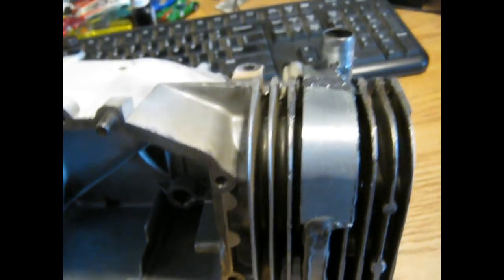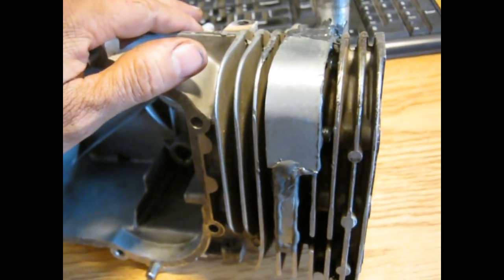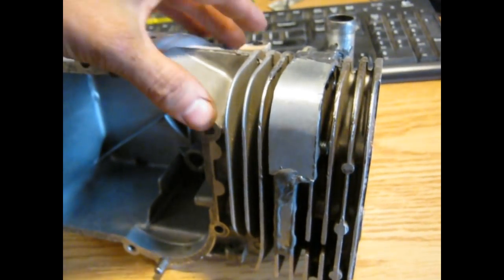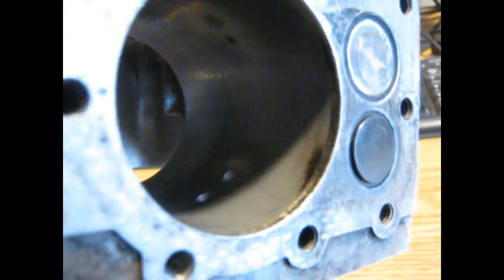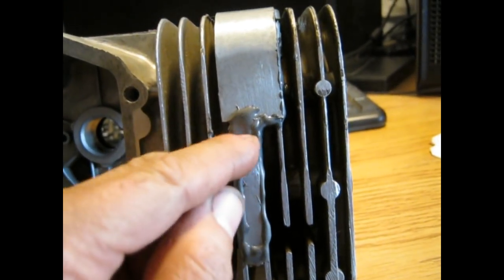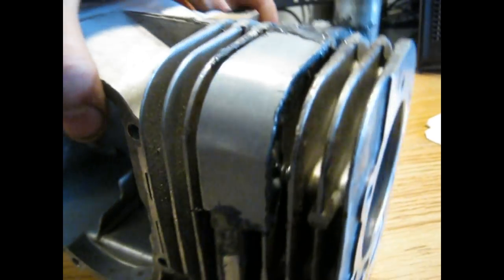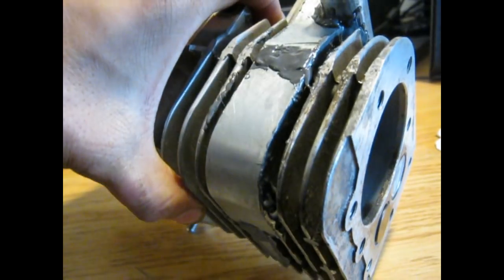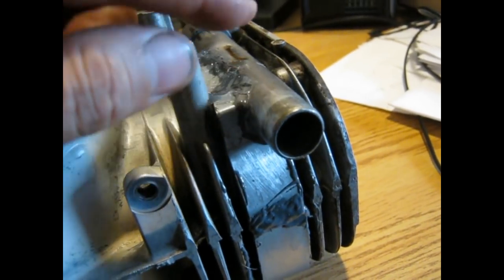Here are the various components I've had to modify for the Chatterton Simplic engine. Here's the basic four-stroke Briggs lawnmower engine block, and the first thing I did was drill ports in the cylinder wall — you can see them going about halfway around. They lead into this belt here — the intake belt I call it. It goes in between two rows of cooling fins and expands out into this full width to give it more area. That's JB welded in place, and it connects up to the standard intake manifold pipe.